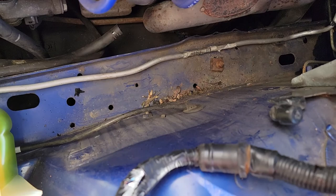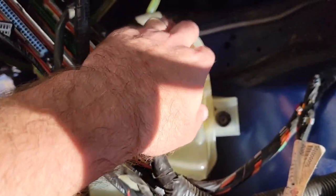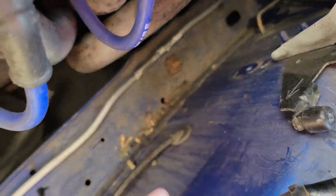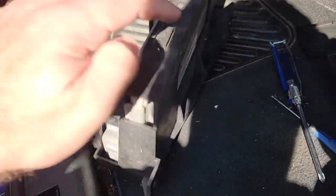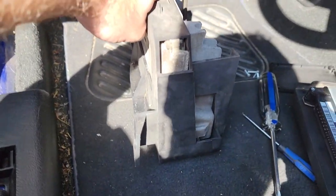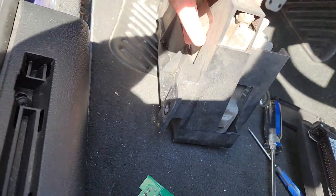These are the connectors to the ECU — these two big ones below in the green. The ECU typically sits right here; I actually got it out. It's held in by two bolts. You have to move the coolant tank first to get access to it. You move this bolt here and this one over here — that's a little tougher to get to. It just sits in the case and bolts to that side, but it's right near the headers or exhaust manifolds dealing with a lot of heat. It probably would never cause an issue, so I was mostly doing this for space in case I ever decide to swap out the shorty headers for the long tubes.